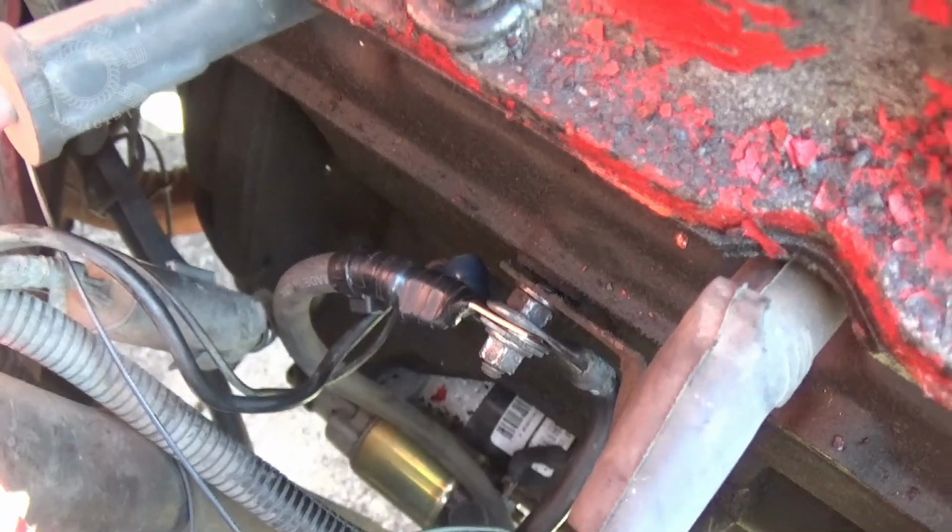Now as you put your cables back together on the side of the block, make sure that your battery cable, the negative coming from the battery, and the cable going to the frame that we installed down there, are the ones touching together. Then the one that goes to the chassis, the one that had the crimp connector ring, put it back next to the block or something like that, as long as it's in the stack somewhere. But be sure that the battery cable and the chassis ground that's going to the frame need to be touching. Therefore, they got the best contacts possible. And there we go. It's all put together.